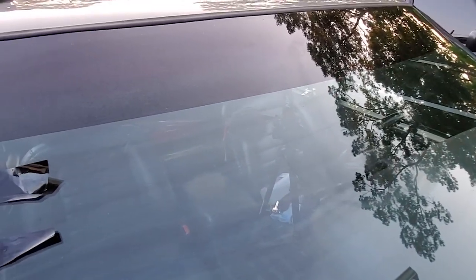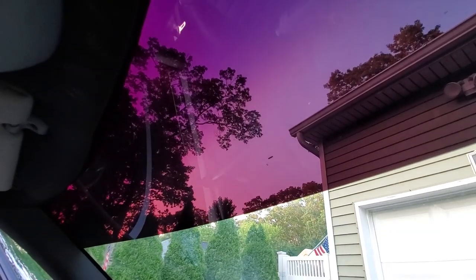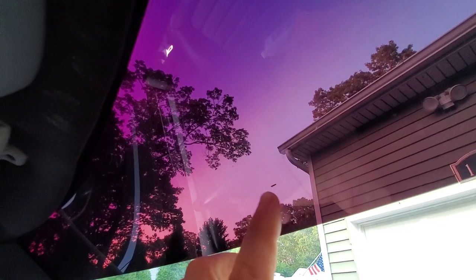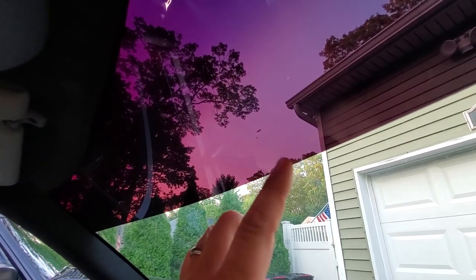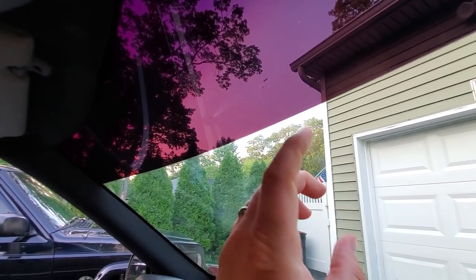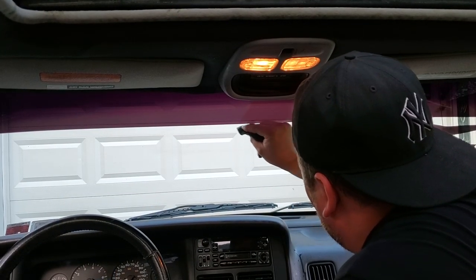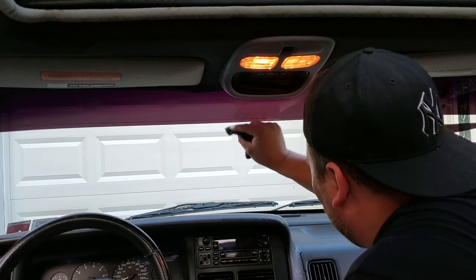Let's make arrangements to get that little metal puck glued on here for the mirror. Now, on windshields there's usually a little indicator that shows you where the puck is supposed to get glued on when you're doing a rearview mirror. The puck is supposed to go right here for this vehicle, but I don't want it up there — I don't want to cut tint. Tint is awful when you try to cut it. So I'm just going to mount it right up here, right to the very tippy top of this tint line. So I'm going to do another once over and scrub off all the fingerprints with some more rubbing alcohol and the Scotch-Brite again. I'm going to scrub the heck out of this whole area, right in the middle, right where I want to mount this puck.